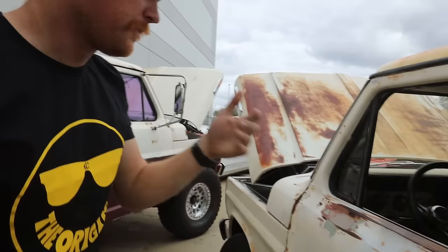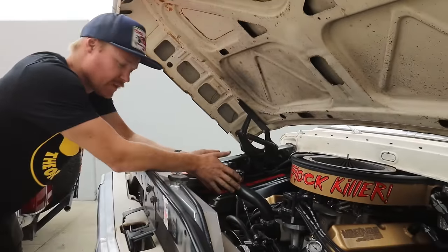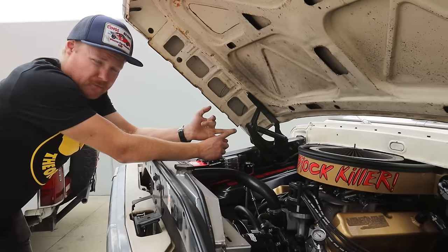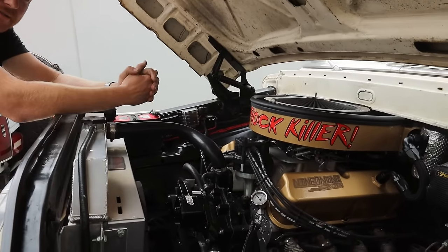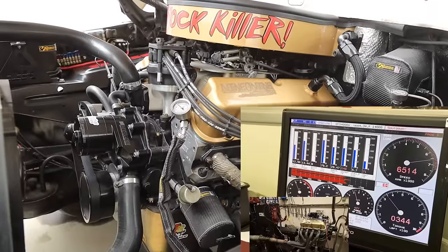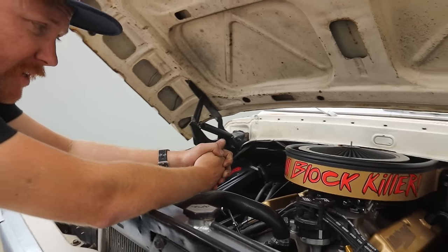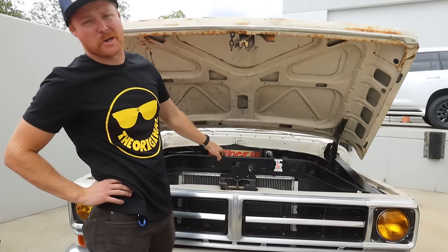The most important part of this truck is the 306 cubic inch small block Ford I designed and built myself. It has a stock D1 '71 date-coded block with the original matching-numbers crankshaft cut three times, 30 under, polished and rebalanced, Scat rods, and custom billet RaceTech pistons. I engineered these with RaceTech, picked the compression ratios to spec with AFR heads. There's a full engine build video — this motor spun 7,600 RPM and made over 507 horsepower on the engine dyno.